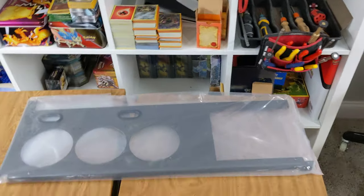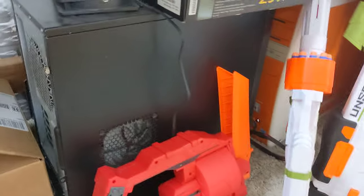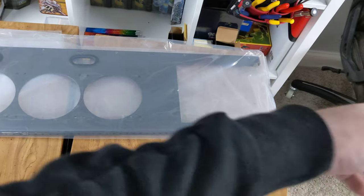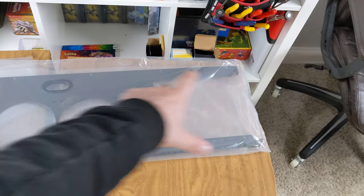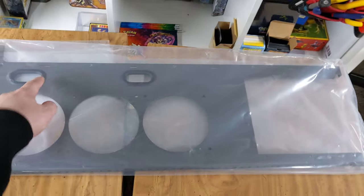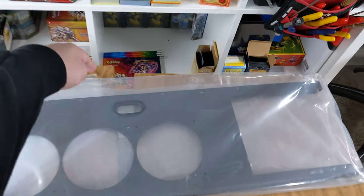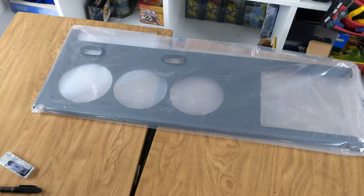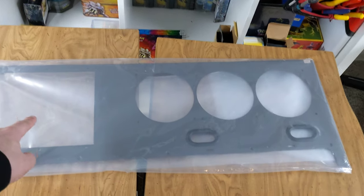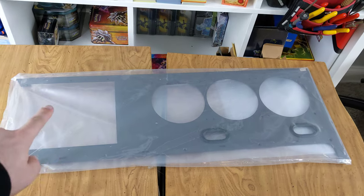If you're wondering — my case is reversed. Normally you've got a computer case here: side panel is here, rear fans there, and the front's on that side. So this is the leading edge when you open the door. This is the front where you can take that piece out for five-and-a-quarter-inch bays and your fans, and then the motherboard tray goes right here and that's your cable management room. However my case is the reverse, so if you put this the correct way it doesn't work — now in the correct orientation because my case is reversed and upside down.